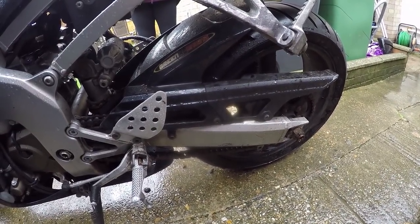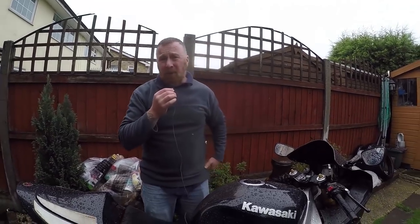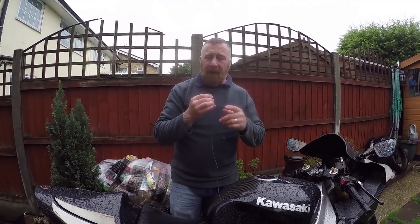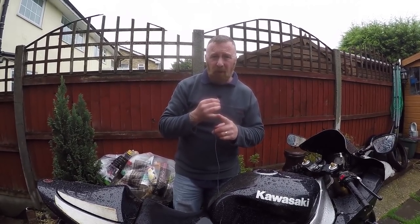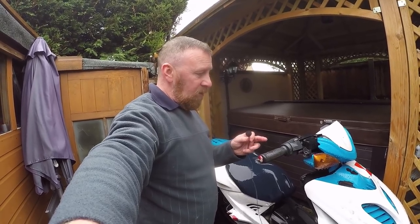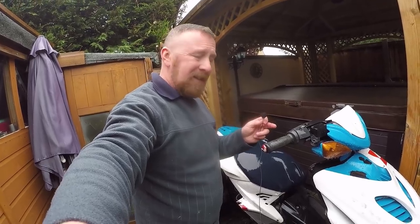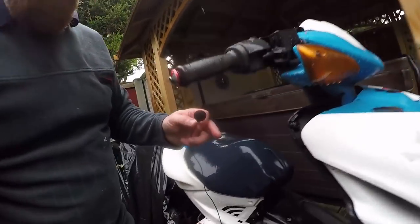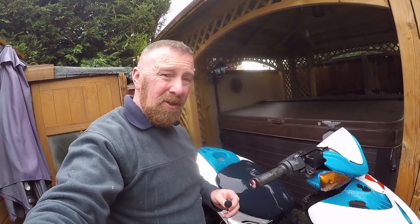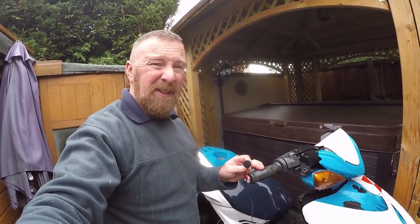If it's got a chain, make sure it's well oiled — there are lots of maintenance sprays, greases, and oils out there. You don't want it looking like this one. Put it on a paddock stand and clean it all up. For peds you don't have to worry about the chain, but you do have to worry about other bits — they're generally left outside a lot more than precious bikes, so it's all about WD-40, doing the brakes and the accelerator cable. Because they're out in the weather and not made of the best quality, they do rust and can snap — seen that before.